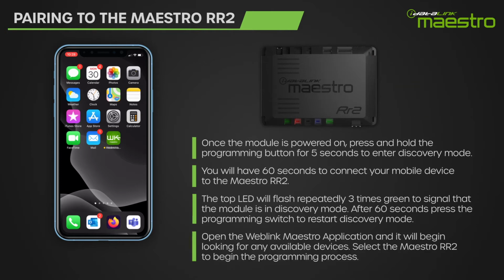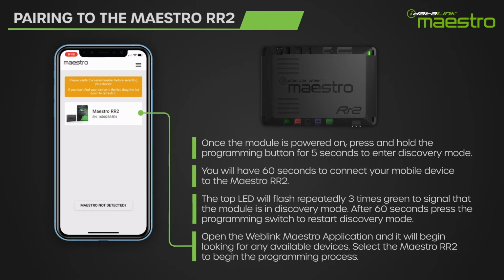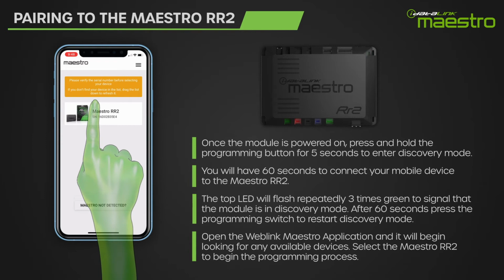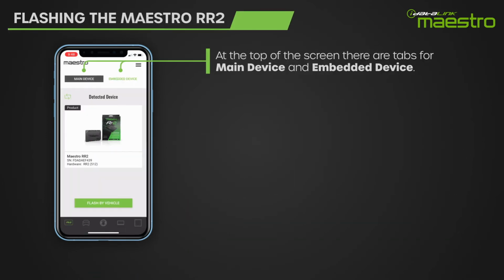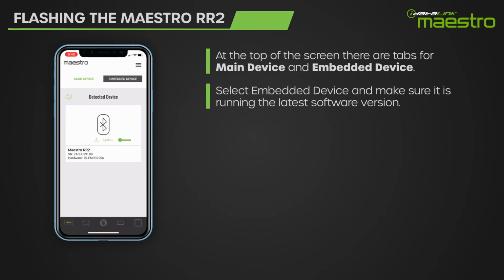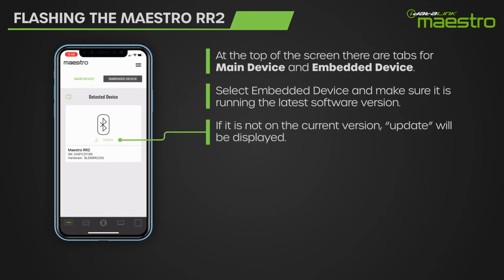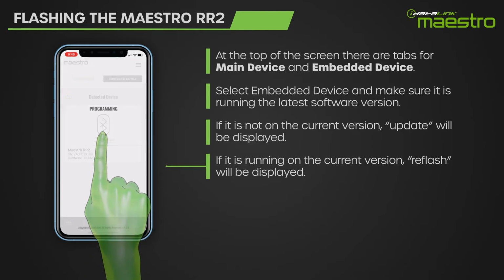Open the Weblink Maestro application and it will begin searching for available devices. You will see the Maestro module and its serial number displayed. Select it to begin the programming process. At the top of the screen, you will see Main Device and Embedded Device. Select Embedded Device and make sure it is up to date. If it is not running the current version, it will say Update. If it has the current version, Reflash will be displayed.